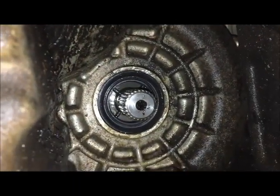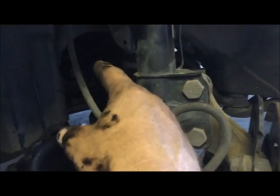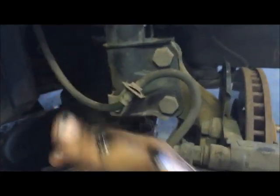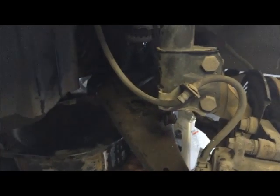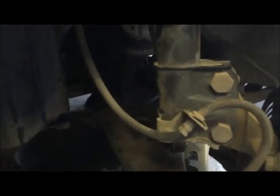There's the new one — it's in there now. You can see all that fluid that's been flinging around in here, so we really needed that new seal in there. Now we can put the CV joint back in. We're going to stick the axle in with that side on the transmission first — remember it's going to go pop-pop, get it all the way in — then rotate this back, stick the other end of the axle in, fold it backwards, and work our way backwards.